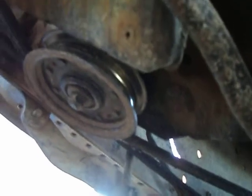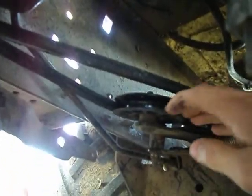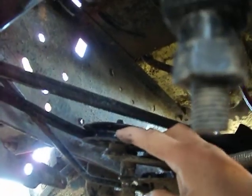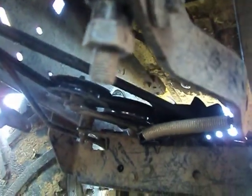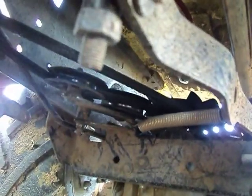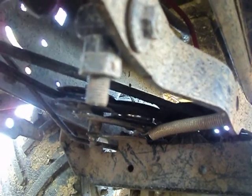Since it isn't a typical feel when you step on the pedal — the thing doesn't move — it's just this tensioner. I'm going to convert it to chain drive so I can pull trailers and won't have belt slippage. You just pull on this little lever over here, it tightens, but when you press on the brake it doesn't do anything. It's hydrostat.